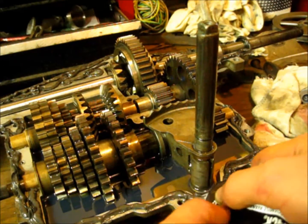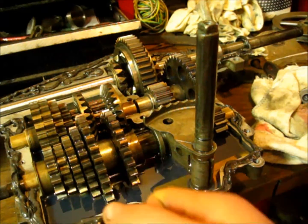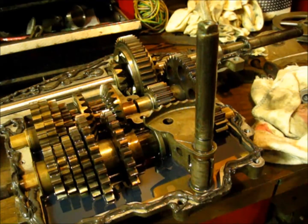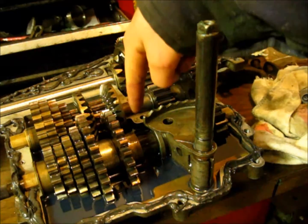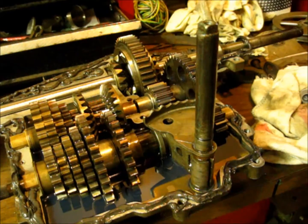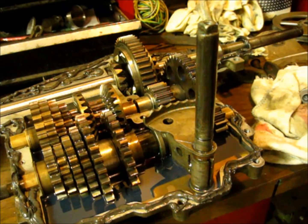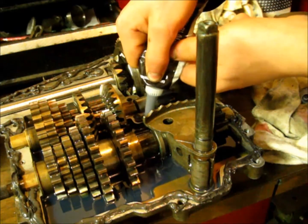Now, there's one thing you should make note of. Just hold on, let me get that. Right in the center here, you have two bolts. Two bolts to go down through or up through, like mine on the Peerless, and you want to put some of your seal on there. Because especially if it's a Spicer or something, that's the key spot. It'll sit right in there and it'll go right into your grease.